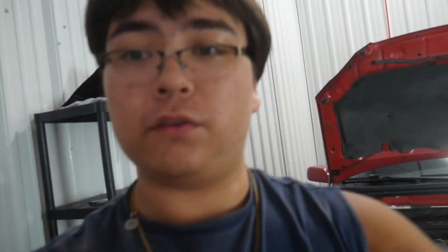A few months ago it was okay and now it's developed a leak. The good news is I don't have to take the oil pan off and I can just do this oil change normally. The bad news is I can't fix this leak right now. I would have preferred if the oil pan was leaking, but unfortunately it is not — it's the timing chain cover gasket, which is a much, much bigger job than an oil pan. I wasn't really thinking about the timing chain cover gasket, but now it makes sense.